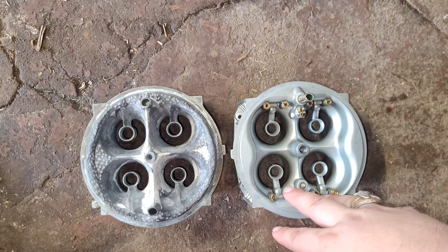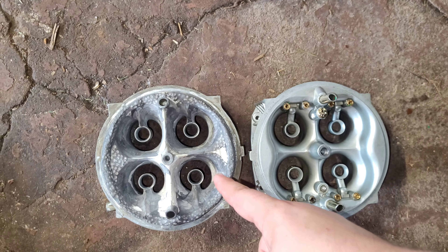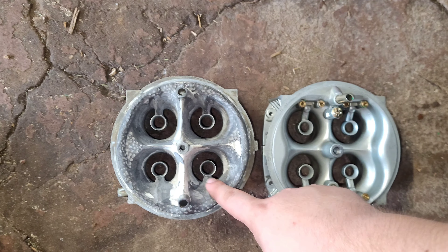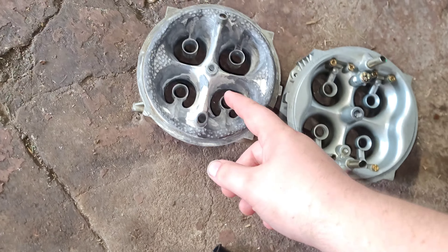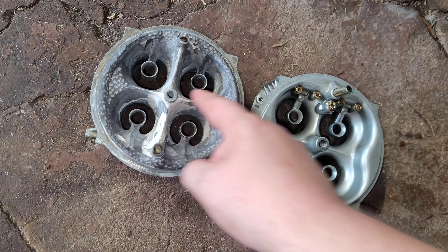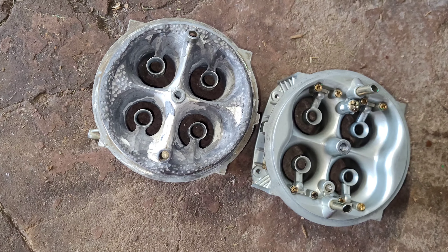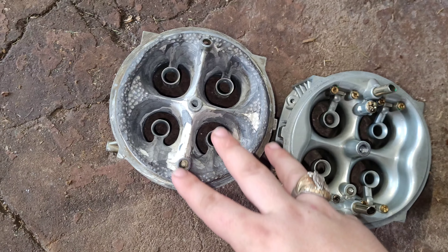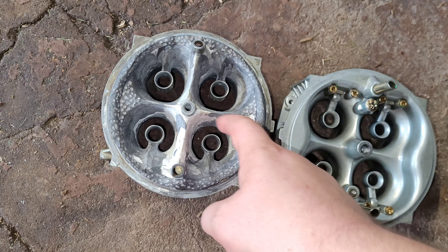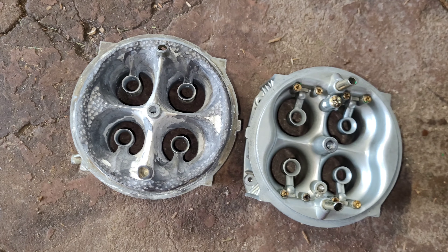What do I mean by more simplified? Take a look here — doesn't that look remarkably similar? This started life as a 600 Holley, vacuum secondary, choke horn, dogleg boosters. We have polished up the boosters, flared out the bottoms, covered all of this in JB Weld, quartered this section off, and made little ramps going towards the booster. We did a lot of massaging on the top to gain more flow and booster signal. We did not change the venturi diameter or the butterfly diameter at all, and we still achieved those stellar results.